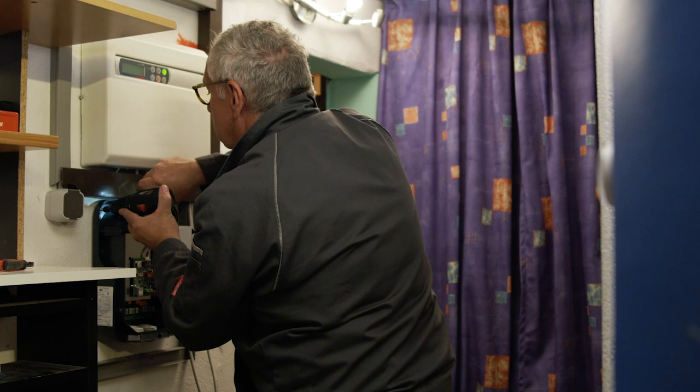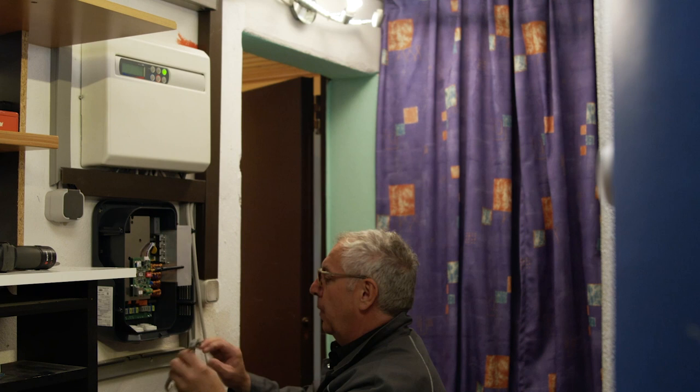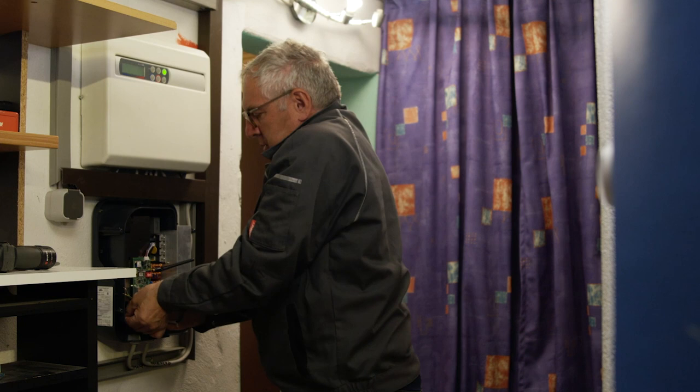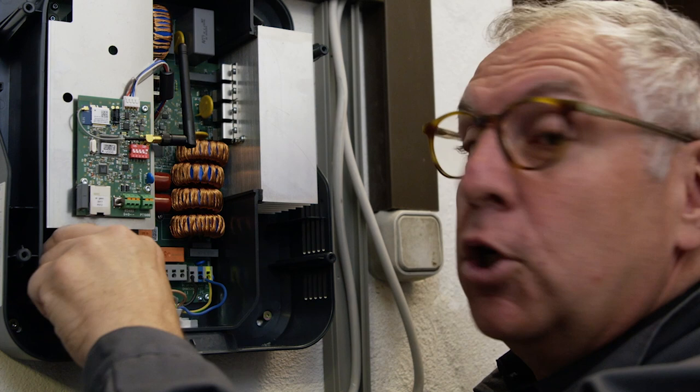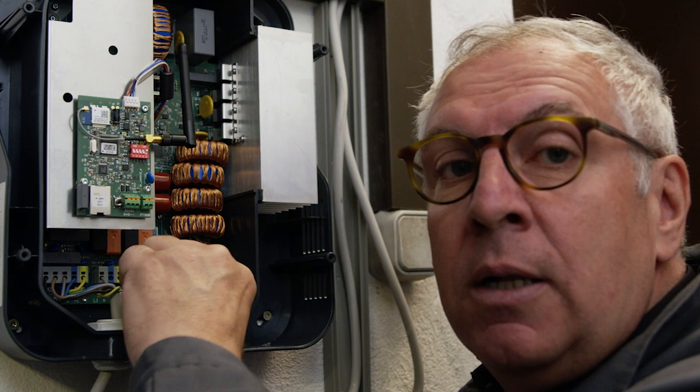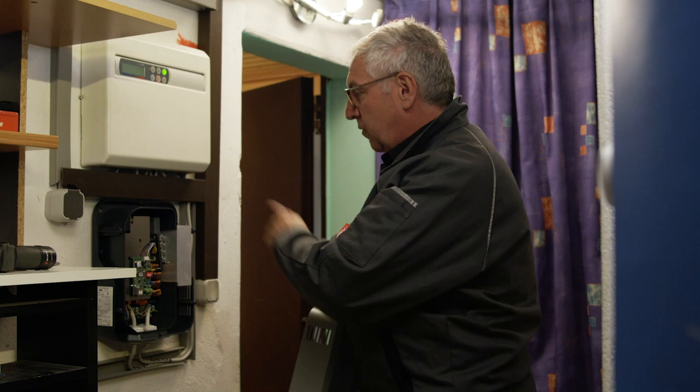We have two power leads. Down here is where we insert the lead that comes from the switchboard. I have now completely plugged in all the cables. That was all pretty straightforward. It's really convenient that where each cable needs to be connected is already marked on the PC board. There's the supply lead that comes from the switchboard and then the lead that goes to the heating rod. That's it. Four screws, connect the cables, put the lid on and done.